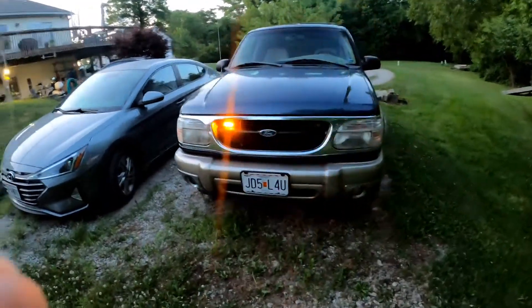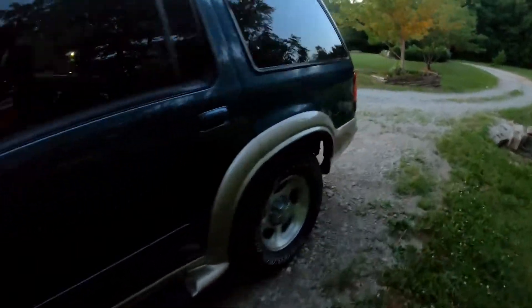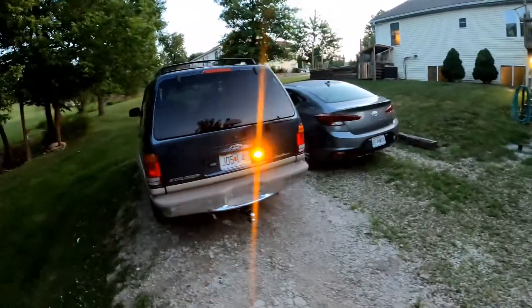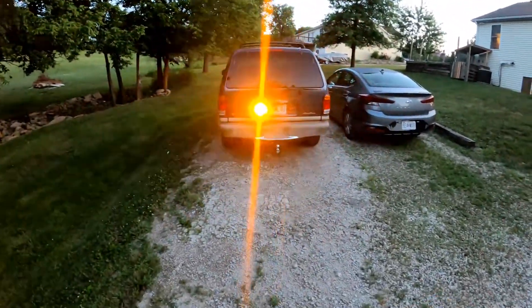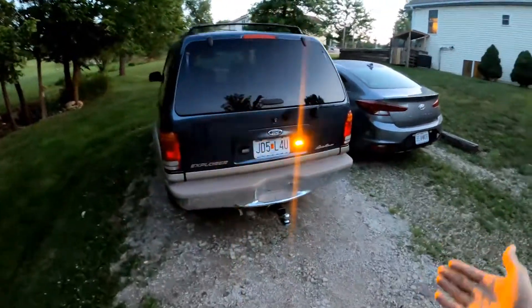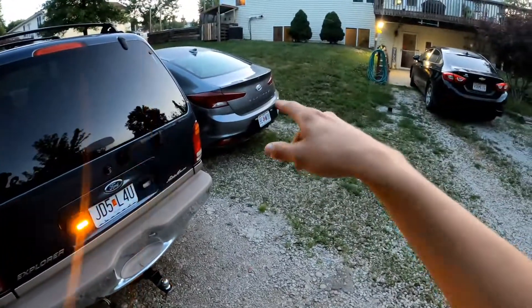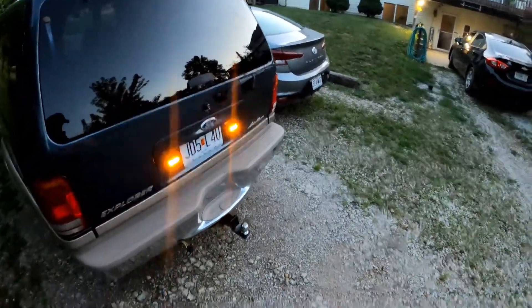They're going to sync together — there's the front along to the rear, they're extremely bright. They are linear lenses, which means they're better for off-axis spread. They're not like the TIR lenses I have on the Elantra which are more of a straight beam, but as you can tell this puts out quite a bit of light.